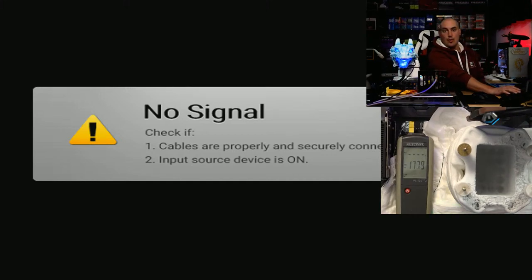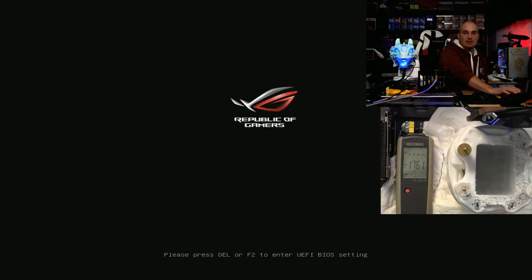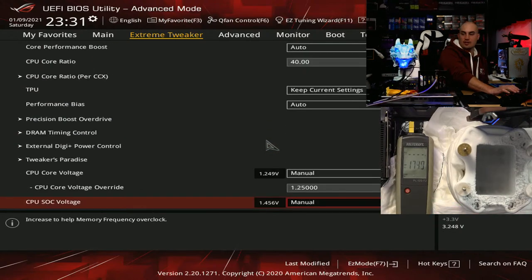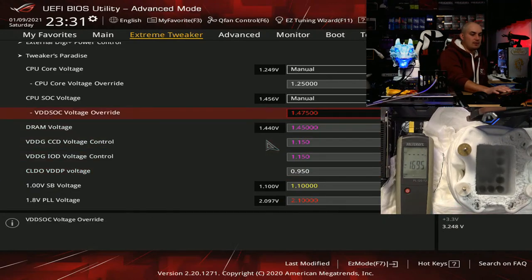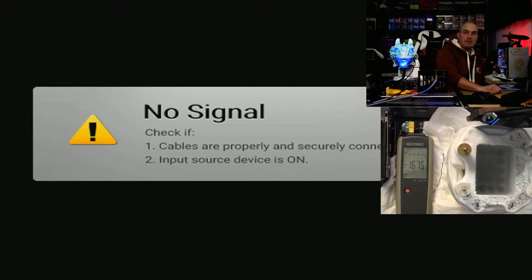So sometimes you just have to play with the settings until you find the one that works. Sometimes something is weird, but it works. It's another world. When you go below minus 130, minus 150, everything changes. Something that on ambient temperature makes sense, in extreme overclock doesn't. And it is like it is. Okay, so yes, I will try last time with enough SOC voltage, and then we will do the other things.